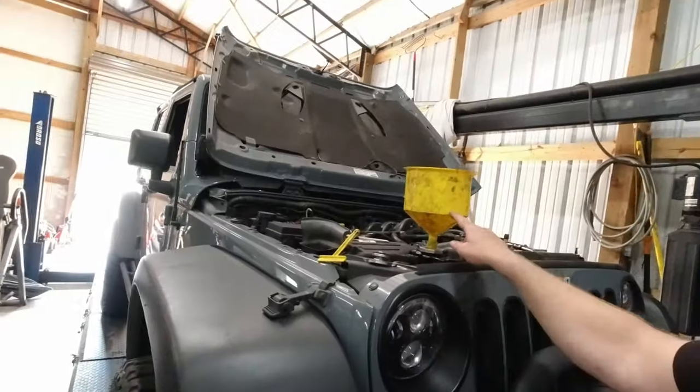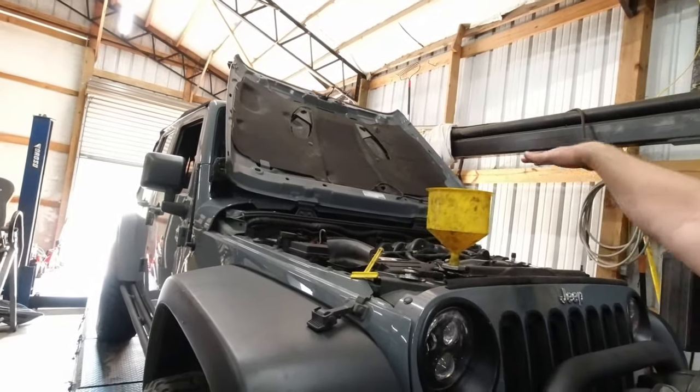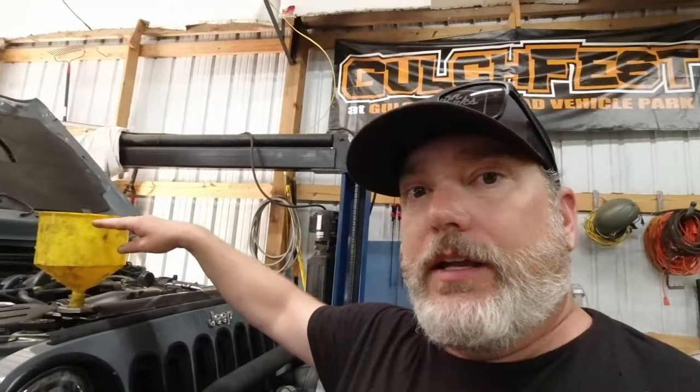These things are problematic with air pockets. When you open a cooling system up and there are lots of lines going in and out in all directions, they tend to form air pockets — little pockets of trapped air that can cause hot spots in cylinder heads or wherever. It can cause lots of damage if you don't get them out. I've got a funnel system that gets the water line up above everything else, so gravity helps push that air out and the bubbles come burping up.